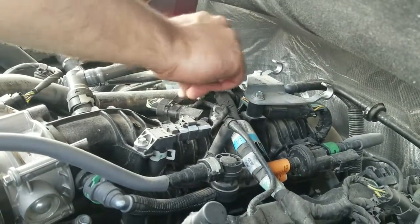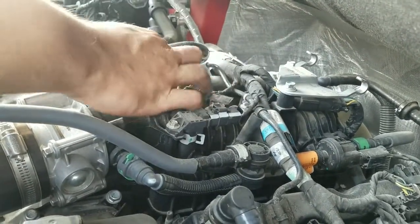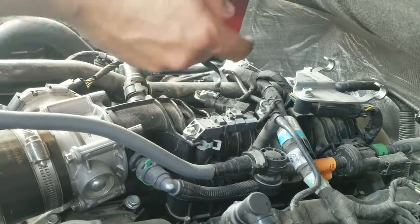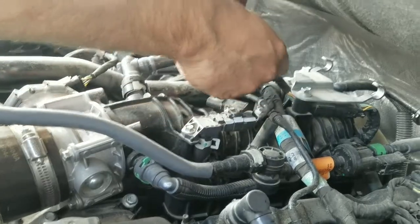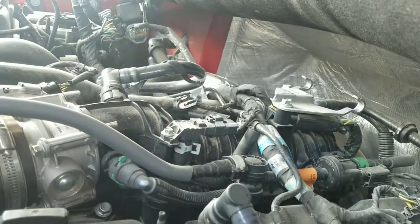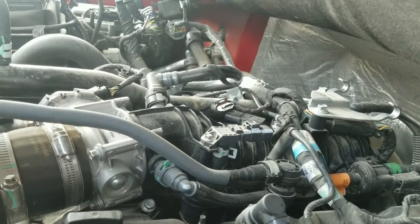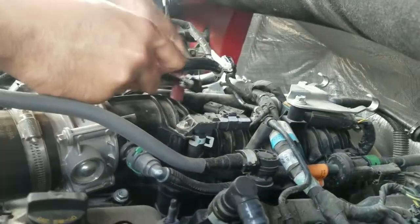There may be tape on this — just take that tape off from around it. That will let you move the locking tab back on the latch rail, then press down and release. As you can see, that is a 3-pin connector. Take the 3-pin female connector on the map portion of the harness and plug it right into the male portion on the map sensor itself.